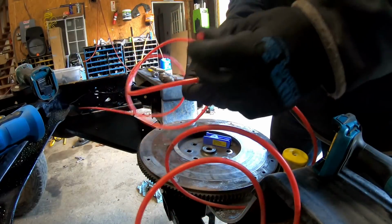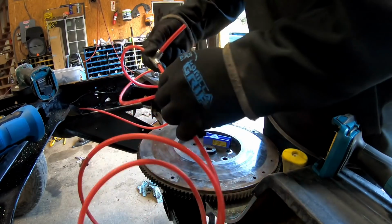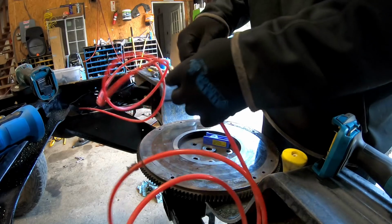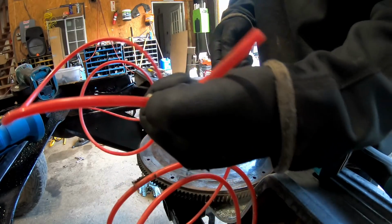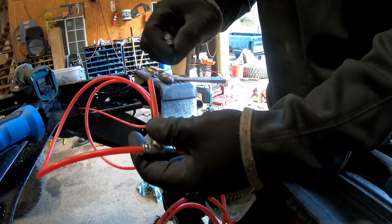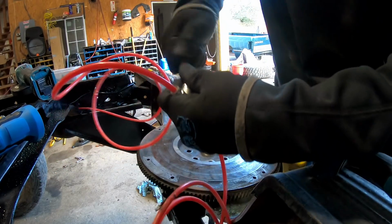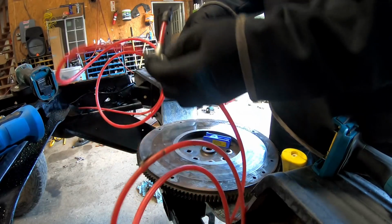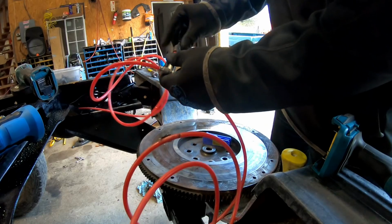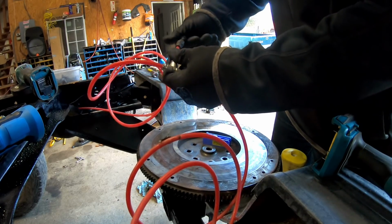If you guys are ever doing these airbags on your truck, don't even mess with the little ones that you have to heat the hose up and slide on. They'll barb inside, and these little air hoses are tough. Get these nice ones that you can take on and off just by pushing down on that thing. With the new Schrader, I'm running them long because I don't know where I'm going to decide to drill a hole in something for this Schrader to fit on.